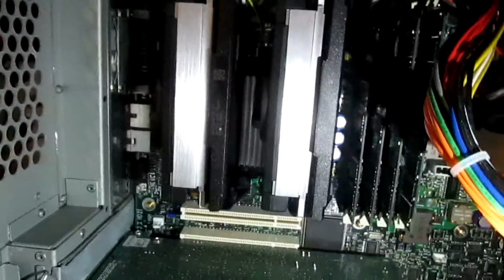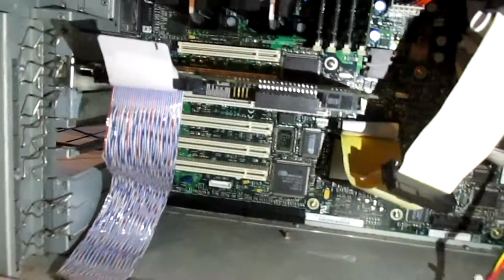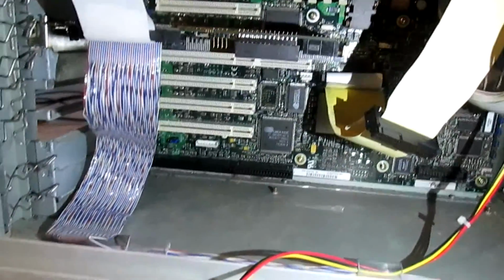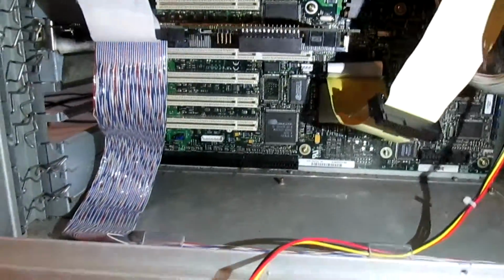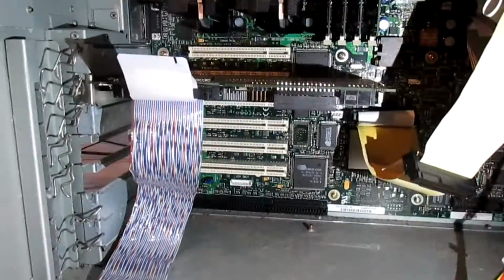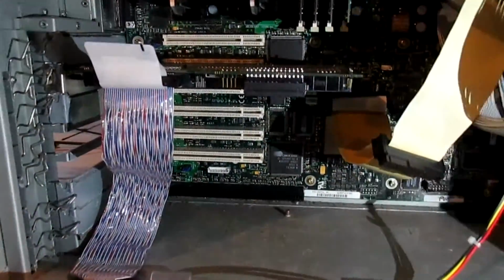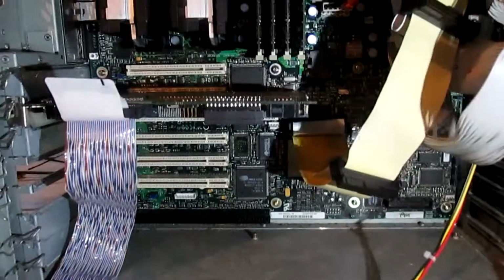Here is the inside. You can see the ECC memory there. The 2 processors, one of which needs to be reseated, but I can't figure out how to get the processor out, so I just keep shoving it in whenever it doesn't work. And the SCSI card. It is an AMI MegaRAID, now LSI Logic. So AMI MegaRAID Express 200. It says differently in the BIOS, but I looked on the side of the card and it says Series 466. A bit of Googling led to me saying that the Series 466 is also known as the Express 200, which is helpful, I guess.